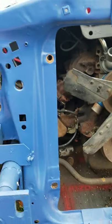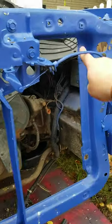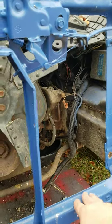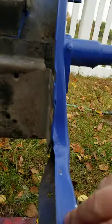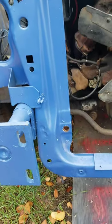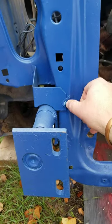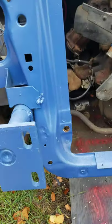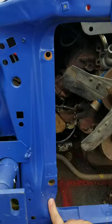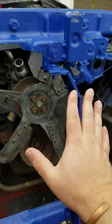What I'm thinking of doing is trimming this all along here on both sides. Now we're going to lose a little bit of structure there, a little bit of spot weld to this thing. I'm going to have to just go with that. I might have to grind down this booger weld — must have been made in Canada. So what I'm thinking of doing is cut this out so you can take this off and put the radiator in from the front.